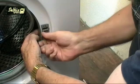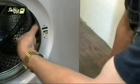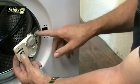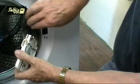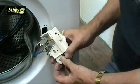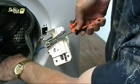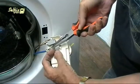There are two wires, a cable and a hose attached, so it will only come out part of the way. Remove the air hose first. This will allow you to pull it clear of the cabinet. Then use a pair of pliers and grip the nylon ball on top of the cable and pull it up and out so it clears the arm of the interlock. You'll probably need to turn the drum a bit to activate the pecker and free the inner cable. I'll explain how the pecker works in the next video.